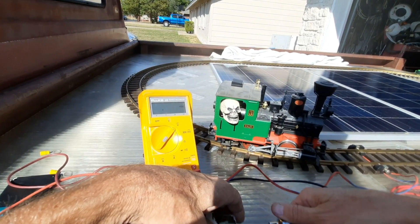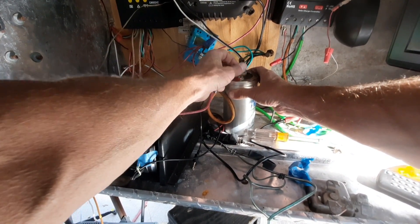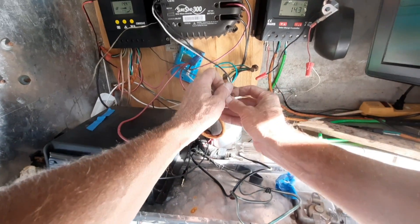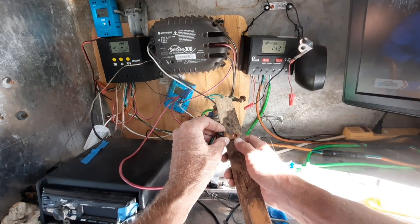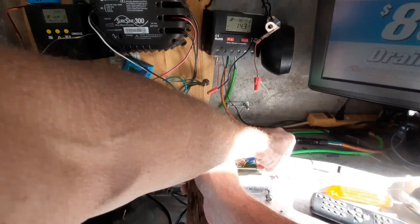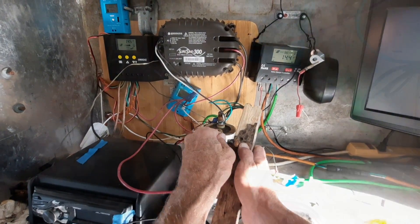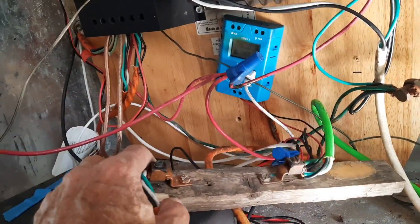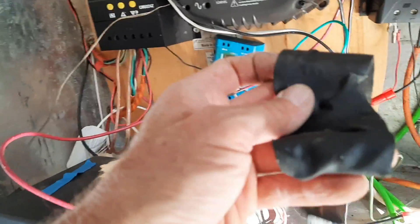The cap will make it slowly start and slowly slow down. I don't want this shorted out on anything, so what I'm gonna do is turn it into a distribution block — if those two touch we're gonna get arky arky. I kind of like this side better. We're gonna put this hot rod in here and turn this into a distribution block — positive, negative — so if I need to clamp onto it I can.